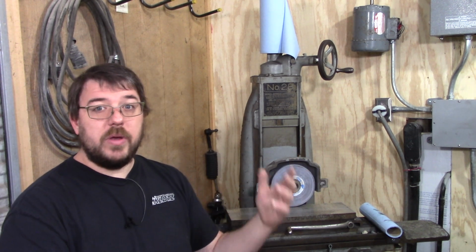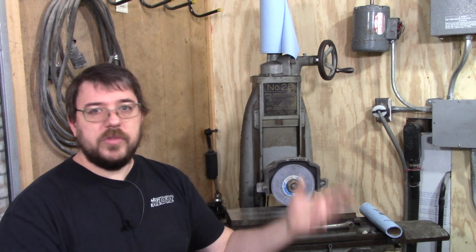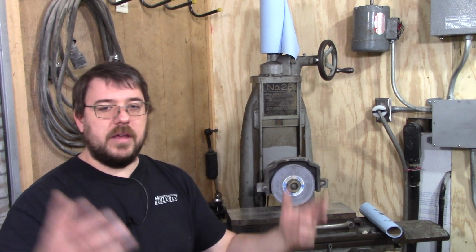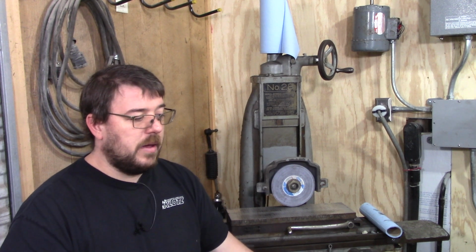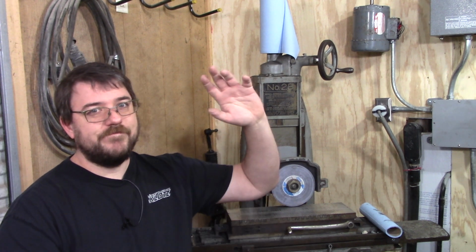So I guess that means we really do need to make that Spintron, and we need to figure out what spring rates we can use and see if we are having lash adjuster collapsing, and figure out how to deal with that. So on that note, I guess that's a teaser for a future video, and we'll see you guys later.